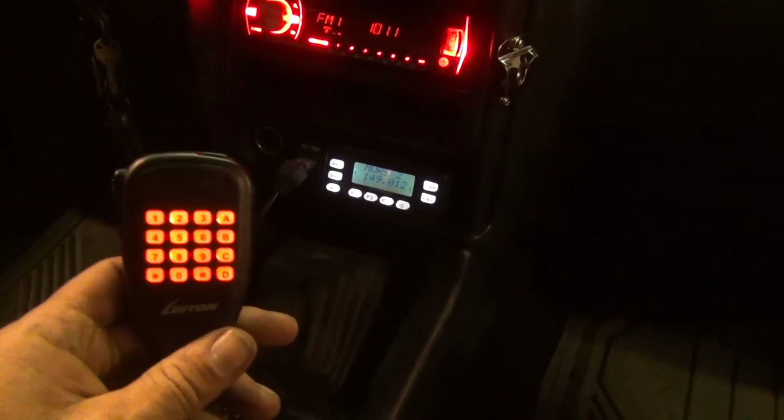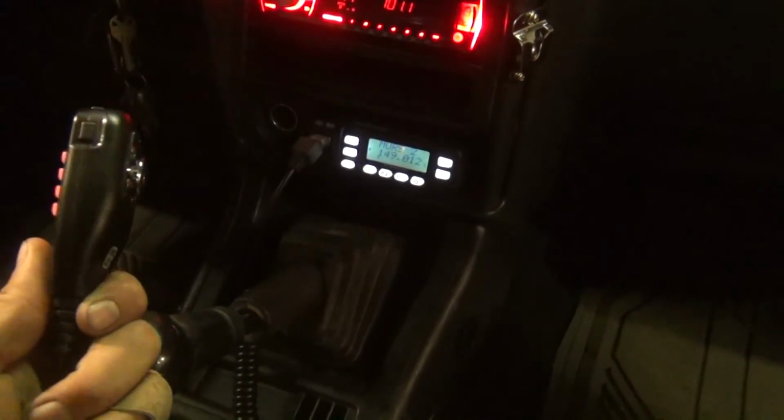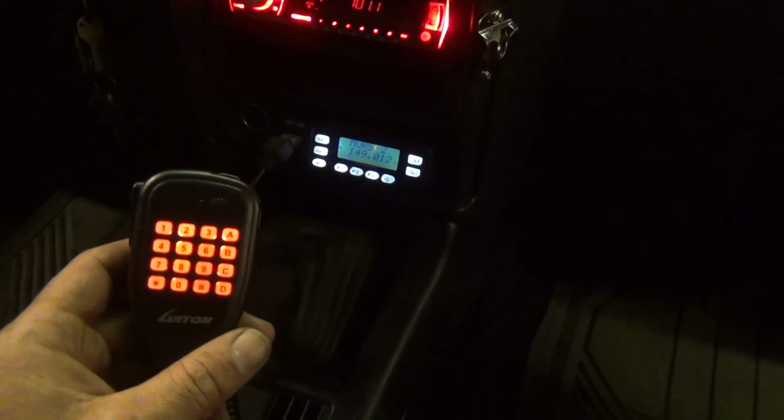And then as far as DTMF tones go, even though I've got my technician license, I don't use my IRLP repeaters all that often. So the only radio that I'm familiar with sending DTMF tones on, you hold down the push to talk button and then key in the DTMF tones. With this radio, it's a little bit different. You actually have to enter a call mode, type in the series of DTMF tones that you want to send, and then hit the push to talk button. And so really it's a little bit less intuitive, but still seems to work.